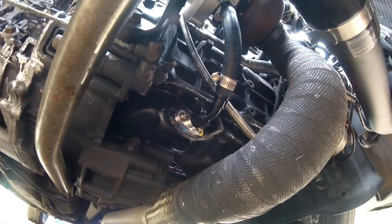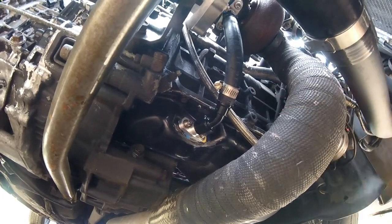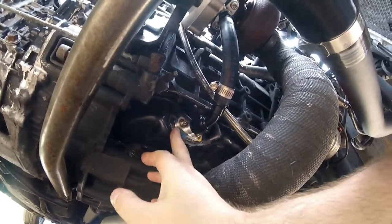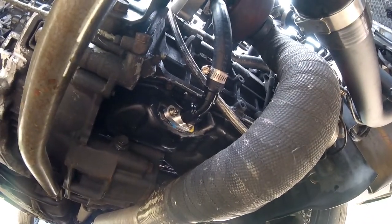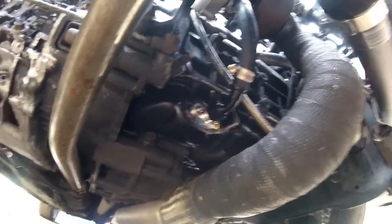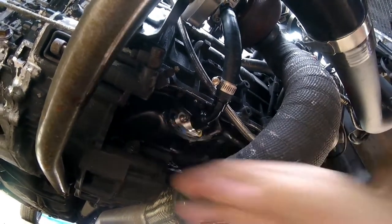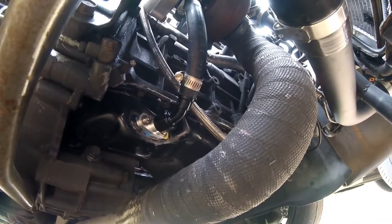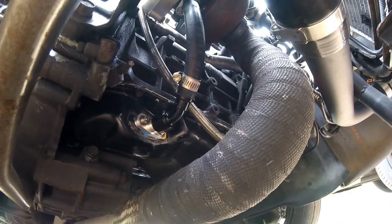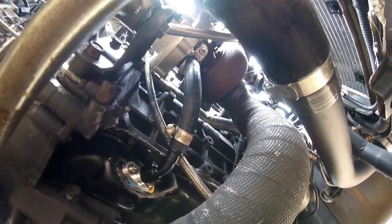What this has is a little bit of silicone for the bolt holes and just a little bit around the return line hole that drains into the pan. The bolt holes have their own washers or grommets to help keep oil from leaking out as well. They're tightened to about 12 foot pounds. I am going to go back and put an allen head on it just to make sure they're nice and clean and tight. Then I went ahead and put on the 45-degree fitting. For the straight fitting, I just reused the original gasket, used a little bit more silicone, and tightened those down pretty good.